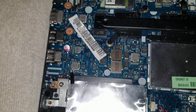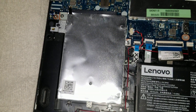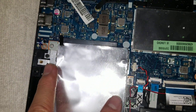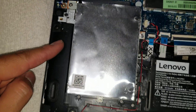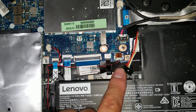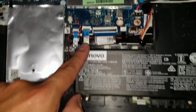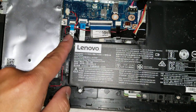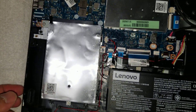If you align it wrong, you can easily break these things. The hard drive here you can remove — you just have to take out the screws that hold this bracket and then you can slide this back. There's the speaker here. You can see the speaker wire going up and it plugs here. Then you've got the backlight cable, keyboard cable, and I believe this is the trackpad cable.